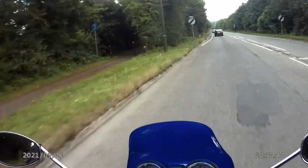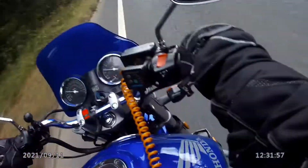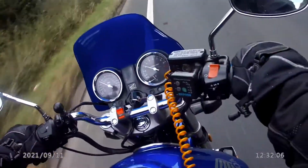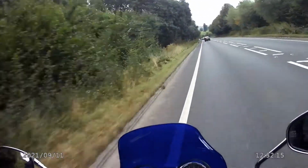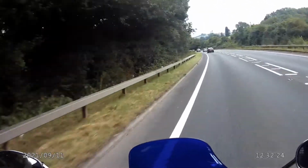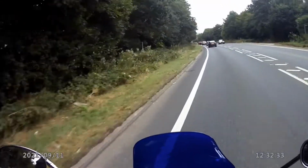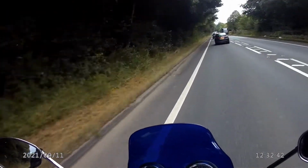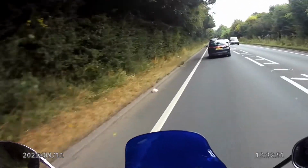My word, it's got a higher boost of acceleration, which is a bit surprising. I think the forks are a little bit stiff. Can't really see. Keep an eye on those. They should bed in. I put new bushes in as well as new seals. The original fork oil was very, very mucky, so I doubt that there'd been much attention to them in quite a few years. I mean, this bike is now 17 years old, and I guess it would have had fork seals removed and replaced, well, at least once.